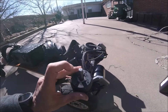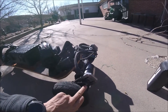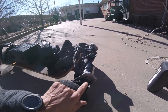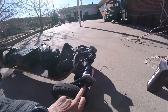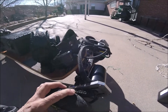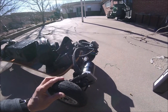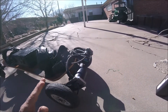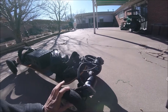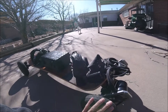The original Amazon motors were 10mm shafts — they make them in 8mm and 10mm. There are just not as many gears available for the 10mm, but I got 14 or 15-tooth gears. Also, the chain wears out about every 600 miles, even the heavy-duty one from scooter parts.